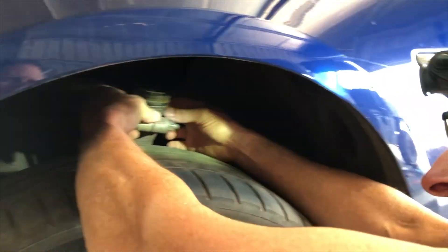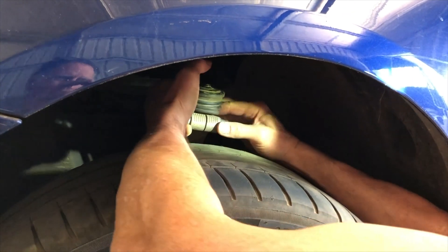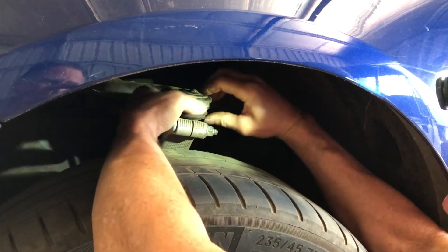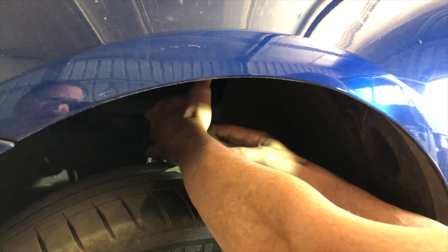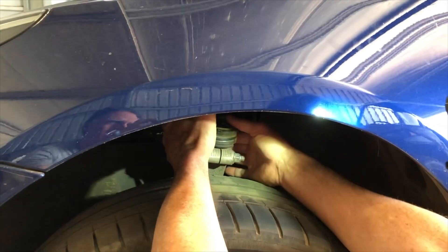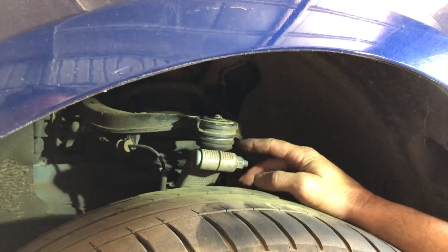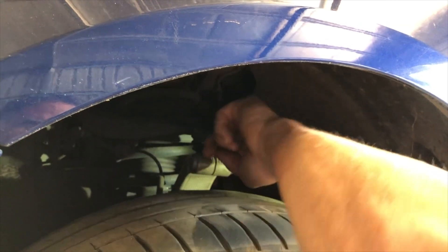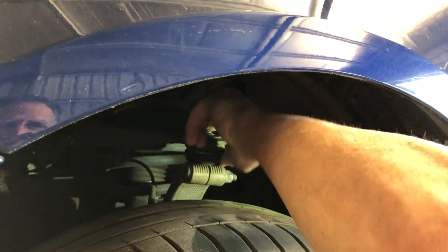About 25,000 kilometres — that should do it. It seems like they just didn't put enough grease in there to begin with. And probably if it does start creaking again, just a bit of a massage of that boot would fix it anyway. The reason for using the very fine needle was just so the hole closed up properly again without damaging the boot. And that's how it's done.